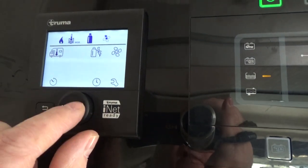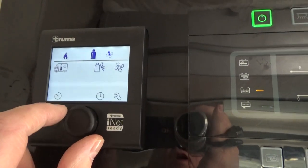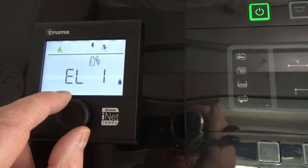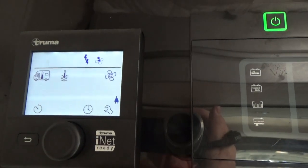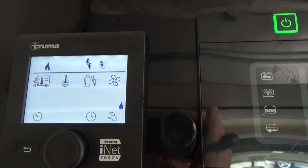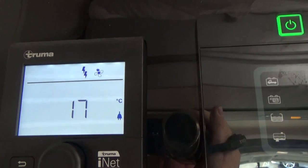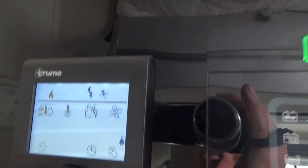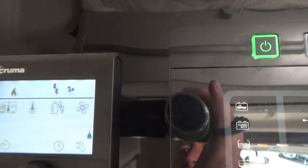Right, so I'll switch on my control panel - that little light shows you're connected to electric. I'll turn the heating on, switch it to 17. I want water off and just electric. So now that will start the heater up and hopefully warm the area up where the frost valve is so I can start priming up the water system, but it doesn't stop me filling up my fresh water tank so we'll start doing that now. I'll put the fan speed onto high as well to get some heat in the motorhome.